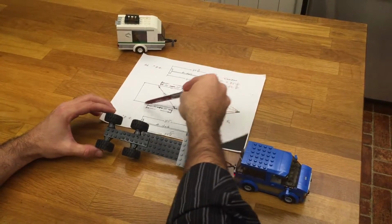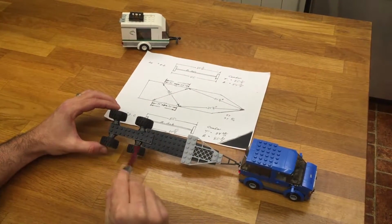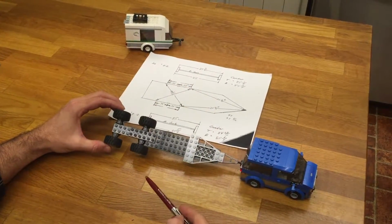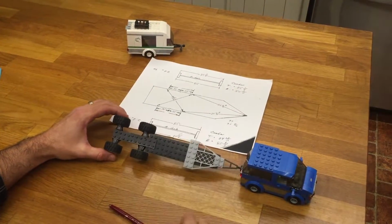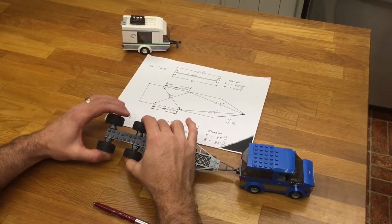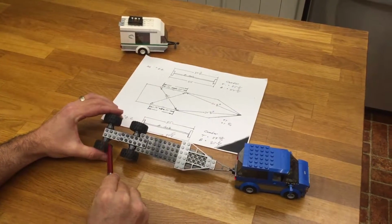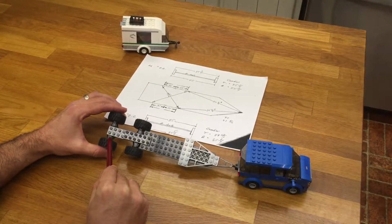You also see this cross where we go from the front hanger to the back hanger and from the back hanger to the front hanger. Those measurements also should be dead on. If they are not, that's where you have a lot of the alignment issues. So the fact that ours is just slightly off means that one of our axles was tracking down the road a little bit off of the other. That's what was probably causing this inside rear wheel to be the worst of all of the four.